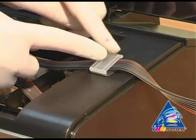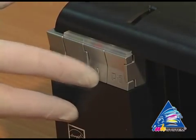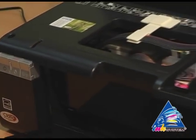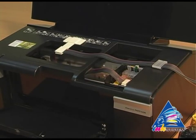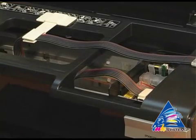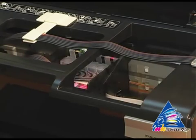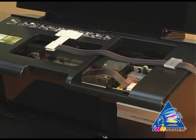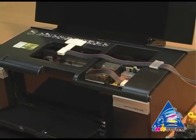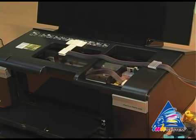After that, close it. Press the red button — after that the printer is able to detect installed cartridges. During installation of new cartridges, the printer automatically cleans the print head. In case there is still some air in the ink pipes after automatic cleaning, please perform the print head cleaning once again.